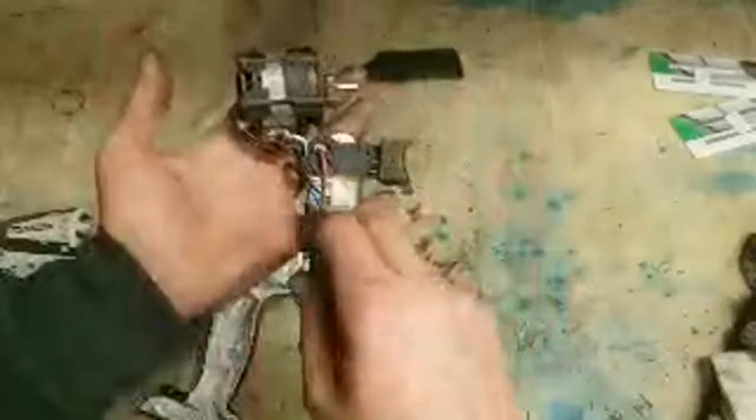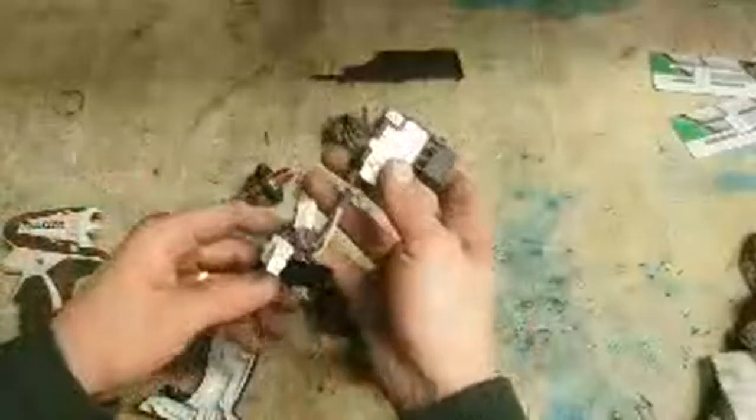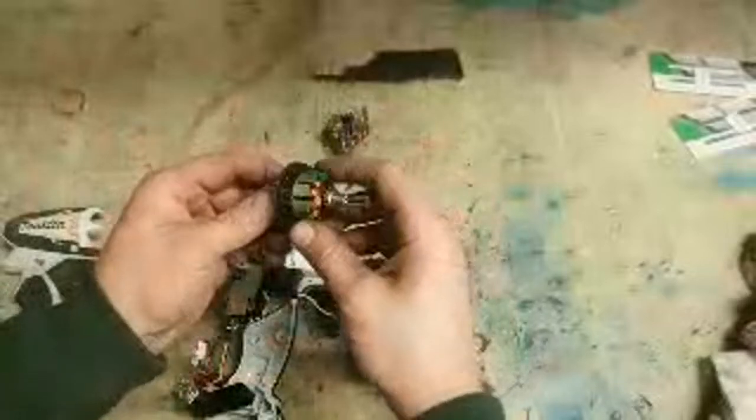In general, with most brands, that's how they come. One solid piece. Rotor, field, stator, controller, switch, battery contacts, all the wiring. One solid piece. Anything goes wrong, throw it all away. Brush motors, you've got a switch, contact, field, brushes, brush holders, bodies, they're all separate generally. But because they're making contact, they generate a lot more heat. That extra heat eventually kills the rotor, kills the machine, especially if it's overworked.